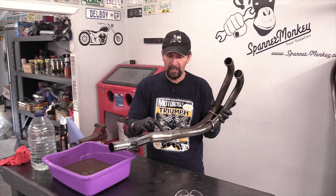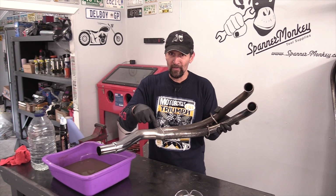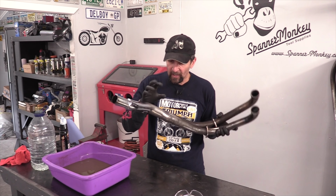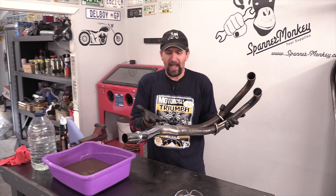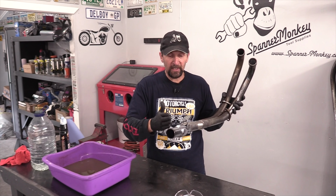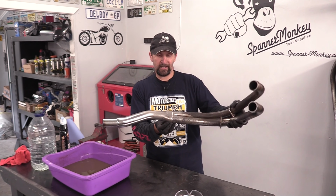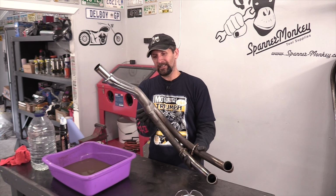because that's the collector. I need that to have lots of integrity because I'm going to bring a third one in right on that. So I'm going to be welding on that metal, and it's superb. There's a little tiny peppering to it, very gently, not much, no more than you would have if it'd been on the road a few years and it just gets pepper marks, the ones you normally get on the front here over years. But look, a linishing mop will take that out beautifully, leave a nice smooth satin finish. Fantastic. I'm really happy with that, and you can still see Triumph Motorcycles stamped in that.